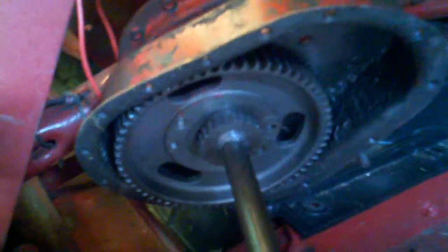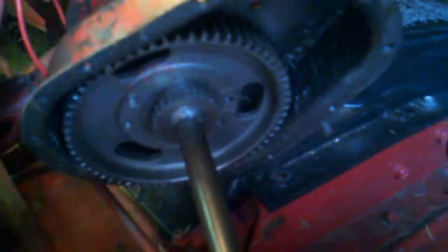The front end is a little goofy on it. The transmission from the one I told you guys about — I had pulled it out of this one and put it in the other — was actually laying right here. I'll show you guys what was wrong with it. I'm on my cell phone, so you guys probably understand why it's so shaky. This actual gear right here — if you look at it, the teeth are actually worn off of it. They should look more like this one here, and they're worn completely off of it.